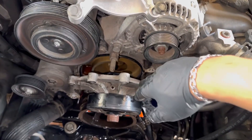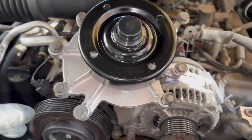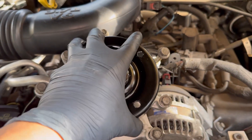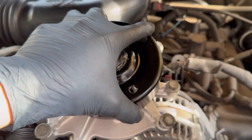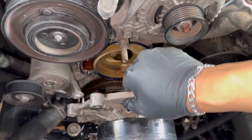I've got the water pump out with all the bolts removed. Quick tip: as you take off the bolts one by one, put each bolt directly onto the new water pump — the reason is some bolts are longer and some are shorter, so you don't want to mix them up. Go ahead and remove the pump; you might have to pry it out with a flathead screwdriver, but this one came right off.